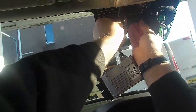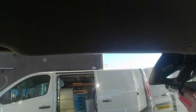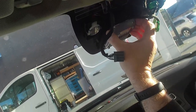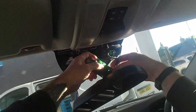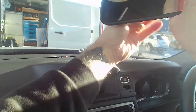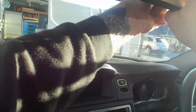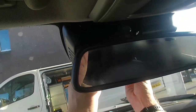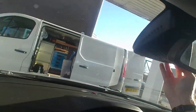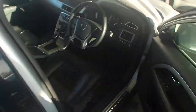Reconnect the rain sensor up. Clip all the cables in. Put the ADAS camera back in position — make sure it's properly in place, as that'll be getting recalibrated later on. Just connect the rear view mirror back into place — it's a round bracket, just a half turn. Twist the rear view mirror back in position. And then finally put the cover back on and clip the final piece into position.